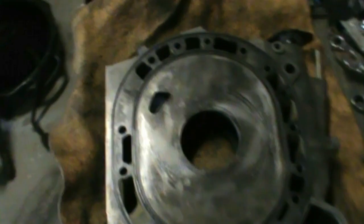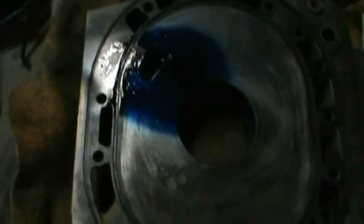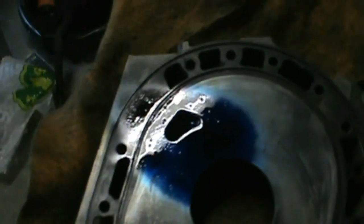So I got it all set up. I'll head over there and show you. Alright, so I got my center iron set up here. I got this toolmaker's ink blue dye stuff. Pretty much just give it a couple good coats there. Yeah, so it's nice and thick — get one more right there. Now I'm just going to let that dry and then I can get my template over here and scribe in the line.